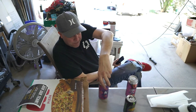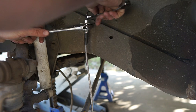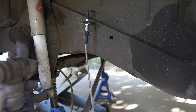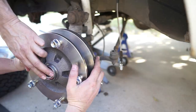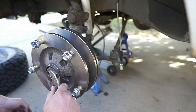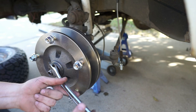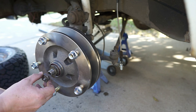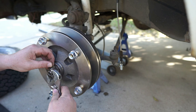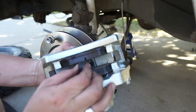We took a pizza break, made a mess, and the bus is apart, but we're back to it. Attach the new brake hose to the brake line, tighten all the connections, and clip it with the little keeper. Slide the rotor onto the spindle, put on the spacer washer, and put the spindle nuts on — remember the driver's side turns backwards. Tighten the first nut until everything seats, add the flappy washer, then the second nut. You want just a tiny bit of drag when spinning the rotor. Flatten the tabs in two different directions to keep the nuts in place.